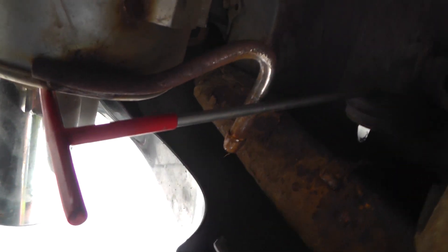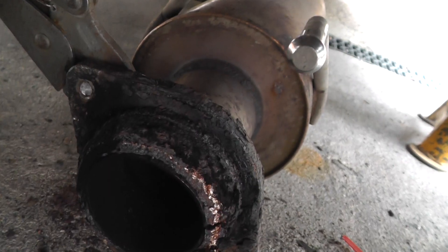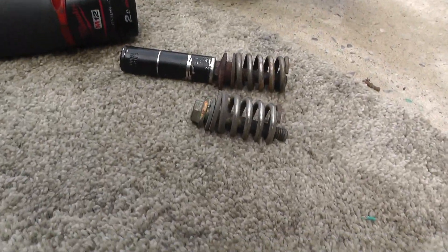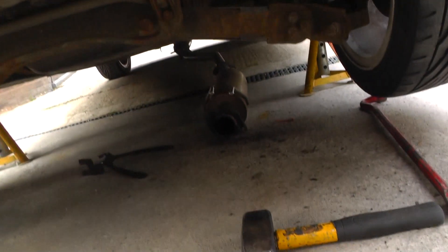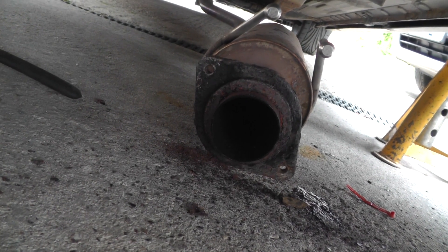That was way too tight because of the length of the midsection, but we're out now. I'm going to undo that snapped bolt with some mole grips. I'm going to need to buy one of these donuts because this one is completely knackered. Got the mole grips on there — luckily it's started moving a bit. A bit of WD-40 on there and let's just wind them out. It's out — you can see this is the bit that snapped, that's where I've been holding onto the grips, and that's how you do that.